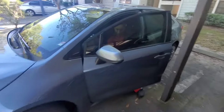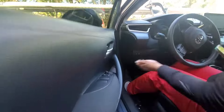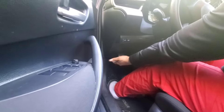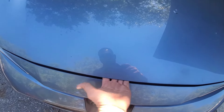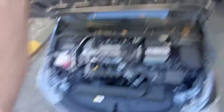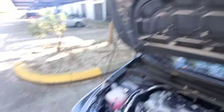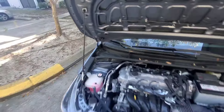First things first, you've got to pop the hood. She's going to show you right where it's at — it is down here. You're going to feel down with your hand, go ahead and pull like so and you'll see the little latch. That's what releases your hood release latch. Then you'll have a secondary latch under here — stick your hand in like so, push it over to the passenger side and then lift up. Then under here you've got a little hood prop rod that goes to where there's an arrow pointing to where it goes.